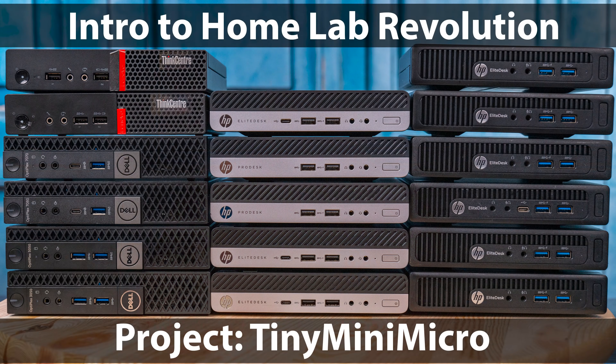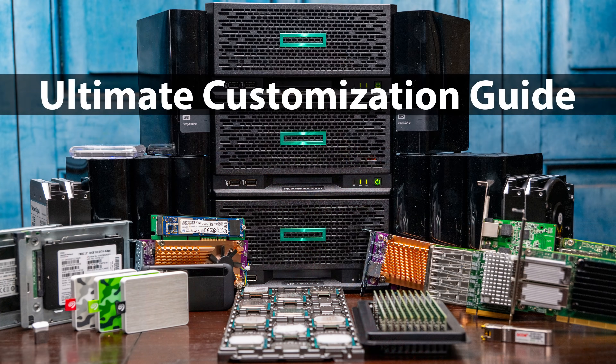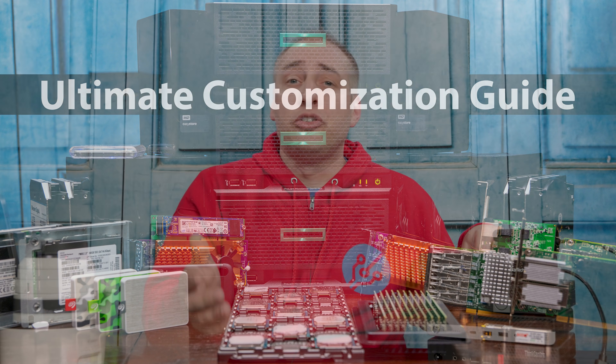Rohit and I had this idea that we would go and get a whole bunch of two and a half gig Ethernet adapters, and we would use those as part of our Project Tiny Mini Micro series. We used them both for these Project Tiny Mini Micro nodes, which are the one liter systems from Dell, HPE, and Lenovo. We could also use them with something like the HPE MicroServer Gen 10 Plus. There are a whole bunch of devices that don't necessarily have the best networking, so the thought was, why don't we look at the two and a half gig Ethernet adapters and figure out which one is best? And then once we finished those, we said, why don't we look at the five gigabit Ethernet adapters? Why not go get twice as much performance? And it turns out we didn't get twice as much performance.